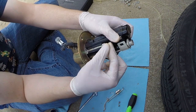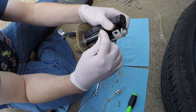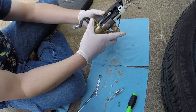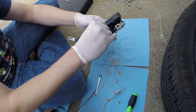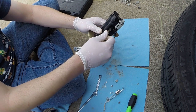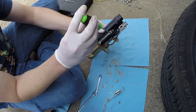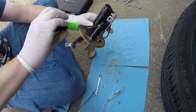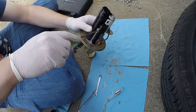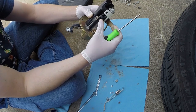You've got this clip here. You just slide it over the top, and then that gives your screws something to bite on. And then we just put the wire right there on top. Slide your screw through and tighten it down. Make sure it doesn't cross thread. That one tried to cross thread on me. There we go. Now it's right. Nice and snug.